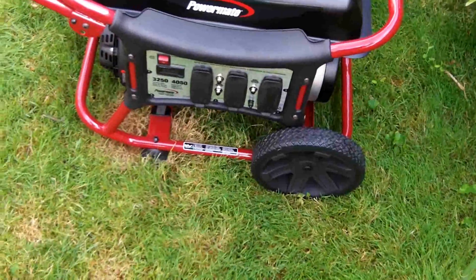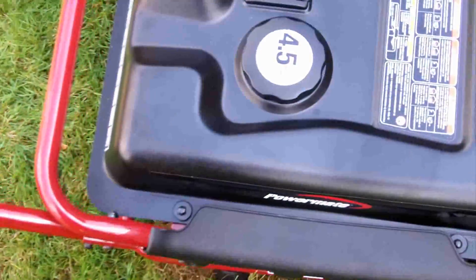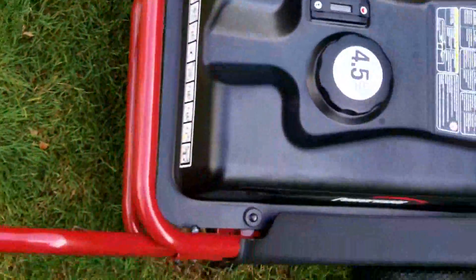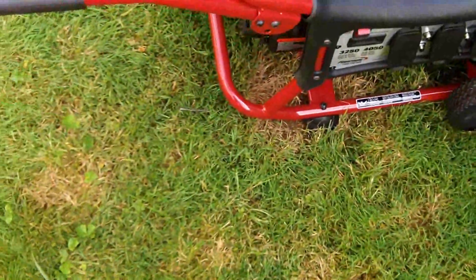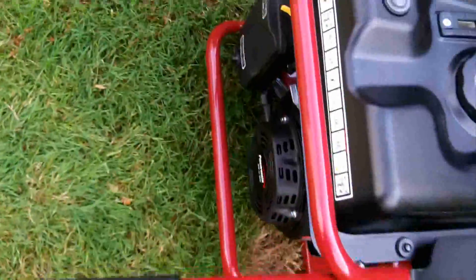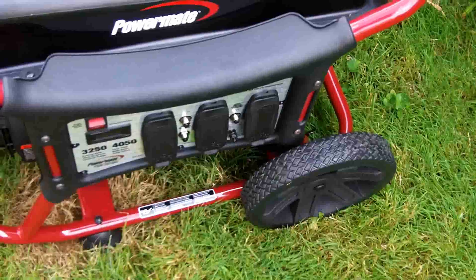I just put a little bit of gas in here, so you can see the fuel gauge still hasn't really moved. The fuel is off and the carburetor is dry from the last time I ran it, about four days ago. I'm going to turn the fuel on — fuel petcock on. The carburetor is already in the choke position, over to the left. I'll let that sit for a few seconds just to fill up the bowl.